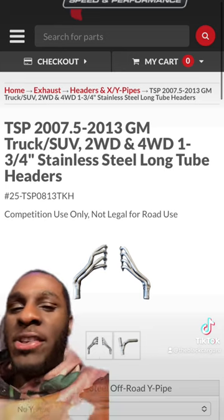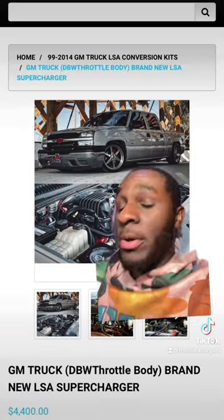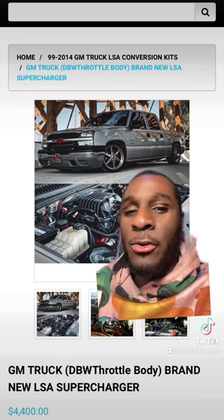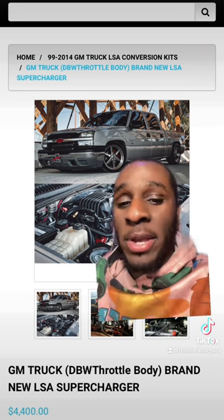With a combination like this, it's pretty mild — you're looking at 500 to 530 crank horsepower. Now, if you're looking to make more power, like 600 to 680, close to 700, do an LSA supercharger swap. That lets you put a ZL1 or CTS-V supercharger on top of your 6.2 L92.